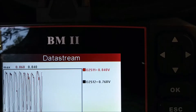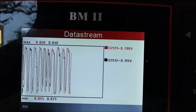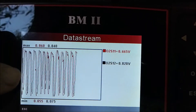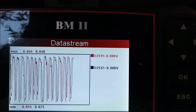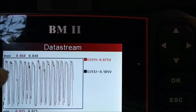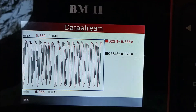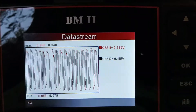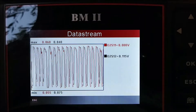It's almost mirroring it - look at it! Whatever sensor one is doing, which is what it should be doing - sensor one looks perfect, this wavy line is normal for the red sensor one. Black sensor two should be much higher and very steady. It can go up and down a little bit, but it should not look just like this. So I am going to recommend that she replace the rear O2 sensor before just assuming the catalytic converter is bad.